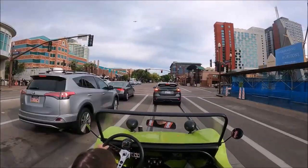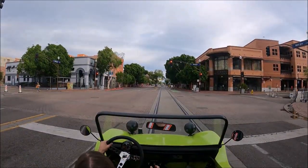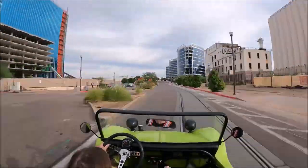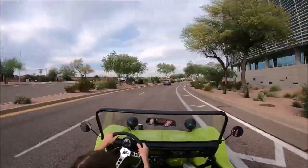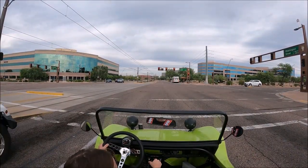Now, despite having the buggy run really quite well and perform as I needed it to, there were still a few issues I needed to address. The original 1600cc engine that came with the buggy, unfortunately, had about 50 thousandths of end play and had really terrible rod knock. I didn't expect it would last very long under these conditions, so I decided to preemptively replace it before I had any serious mechanical failures.